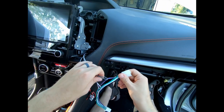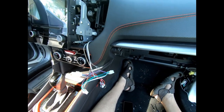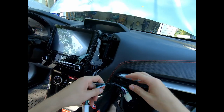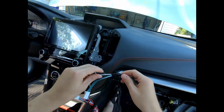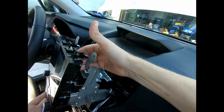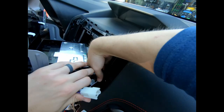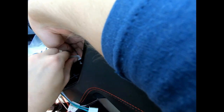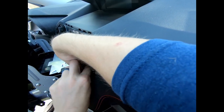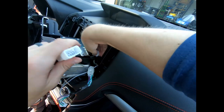Got all these wired — I'll solder and tape them up, then plug them in. I still need to do my ground and positive to the battery terminal but that should be pretty easy. I taped them all individually and then did one big wrap around so one pull doesn't just take it all out. The head unit is back out of the way and I'll take the six-pin harness and plug it into the factory harness — voila. Then I'll find my ten-pin harness and plug that in.